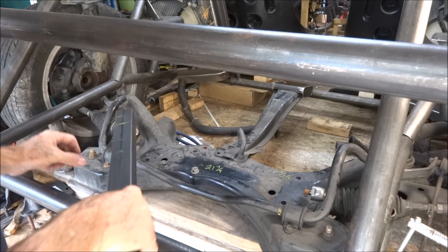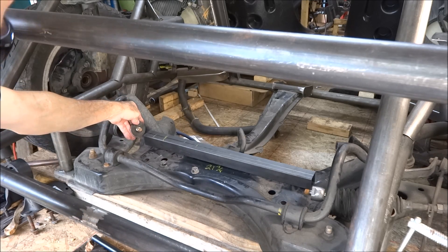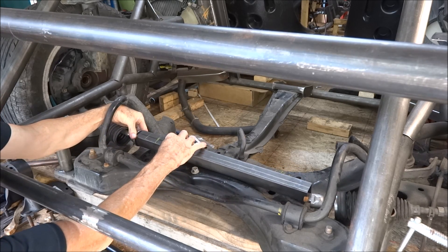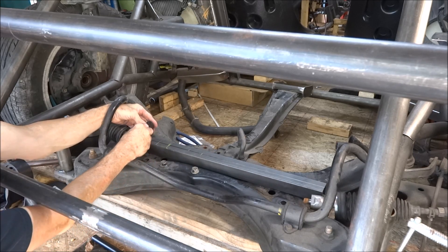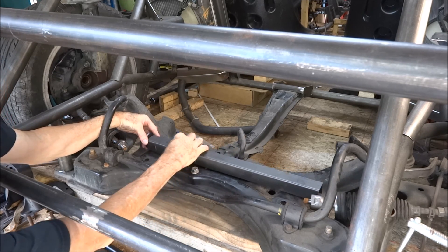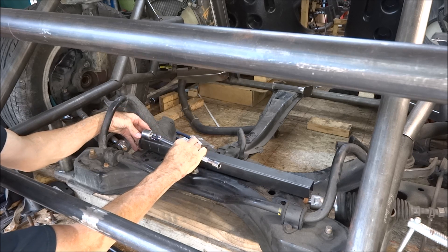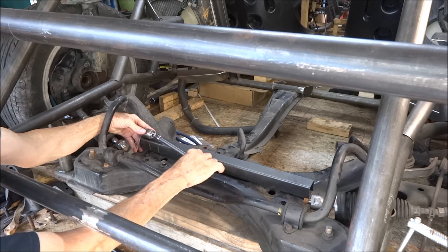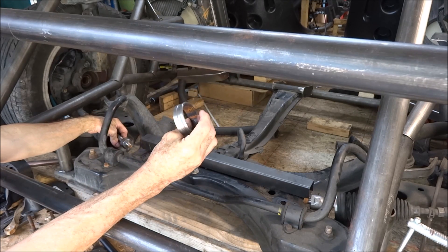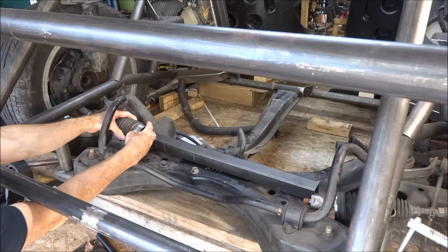Lock them at the exact length of the original steering rack, and do that with this square tubing welded onto the end of it, bolted into place. I'm going to cut an opening between my support brackets so I can get into it after it's been built, and I made a collar to be able to slide the boot up over the top and lock the boot on to protect everything from dust.